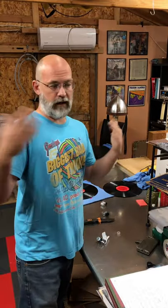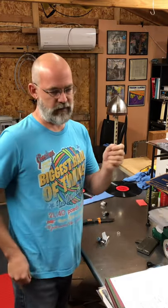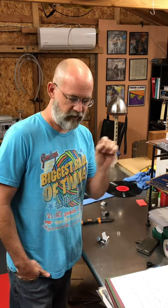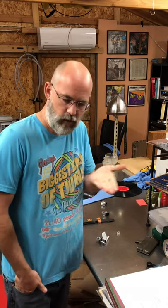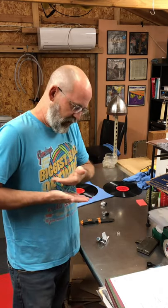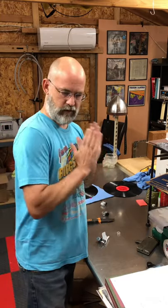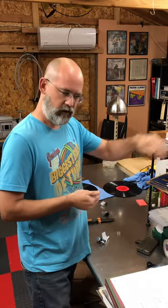But there it is. Hopefully those close-ups will help you. It's very important — you don't need a heavy hand. It's almost like painting: very light, as little pressure as possible. You want to go in gently; you're not digging it out. You're just trying to re-groove — trying to get the walls of the grooves to line back up so the needle can track properly.